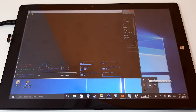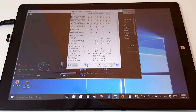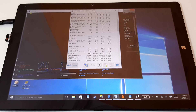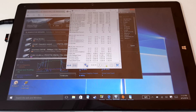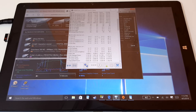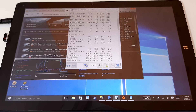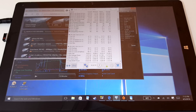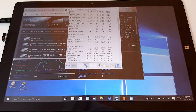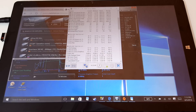Only increase the power in Intel XTU if you've done the thermal mod, otherwise you will damage your tablet — you'll probably reach 100 degrees. That simple tweak has really helped out. When I do my full video review of this tablet, it will be stock and unmodified. The benchmarks I show will be from the stock, unmodified tablet. Thanks for watching — hopefully catch you back in the channel, bye for now.